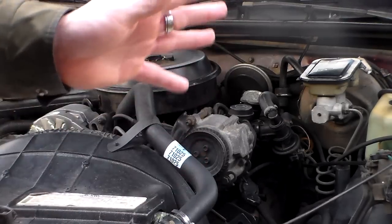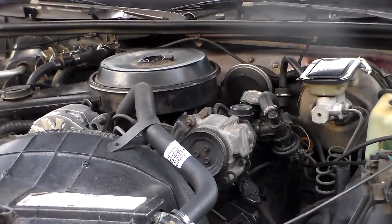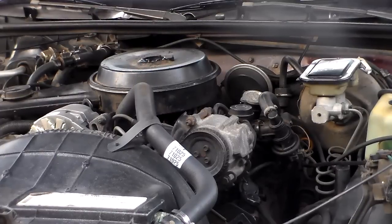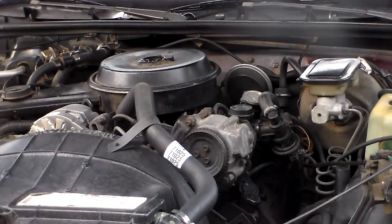So when that rubber deteriorates or breaks like this one, the engine will usually still sit in the same position but it's free to move around. I'm going to start it up — you'll probably notice it might jump around. I'll let it run a few seconds, then put it in gear, and when I do that, you're going to see the engine jump pretty good. Then I'm going to stall the engine up a little bit — give it a little gas with my foot on the brake while it's in gear — and that loads the engine. You'll actually be able to see the whole engine assembly lift up several inches and then come back down when I let off the gas. That's a clear indication you have a broken motor mount.